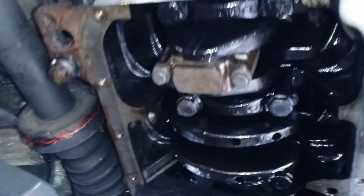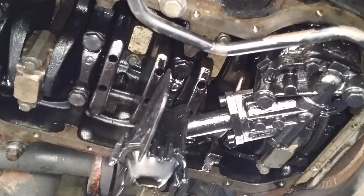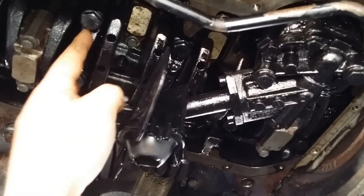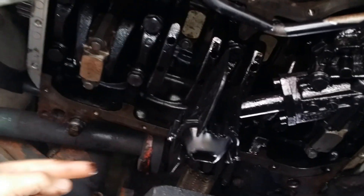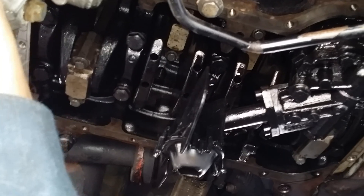It's not hard to remove — the timing belt has to come out. You can see there are about six bolts and this cover will come out. You might have to replace the gasket to get to the main bearings. But honestly, if you change the oil on time, the main bearings will hold up well. This one has close to half a million miles and the main bearings are perfect. The connecting rod bearings were not as good, because the connecting rod doesn't just spin in a circle — it also moves in an oval path, so there's a lot more stress on those.